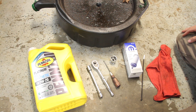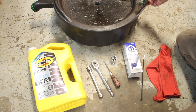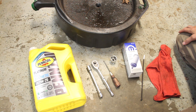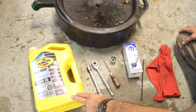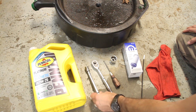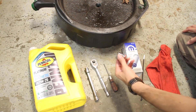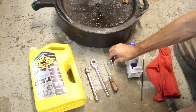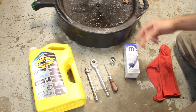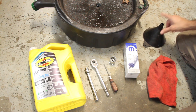Whenever you get that oil change indicator light, it's pretty simple — you'll need to change your oil, and these are the only tools you'll need. You'll need something to put your used oil in, some full synthetic 0W-20 weight oil (Mopar recommends Pennzoil or Shell — that's what they're rebranded with), an extension with a 13mm socket, a socket wrench, a little pick or tiny screwdriver, a 15/16ths socket (or 24mm), a Mopar 349 filter, a rag, and unless you're really good at hitting the hole, you'll probably want a funnel.